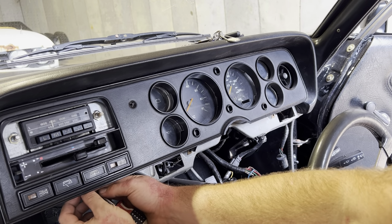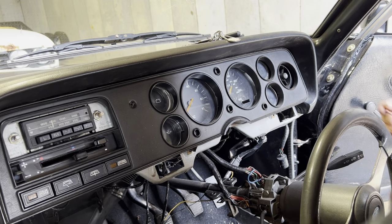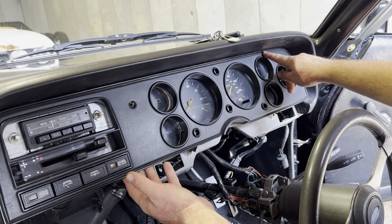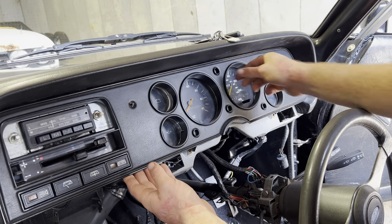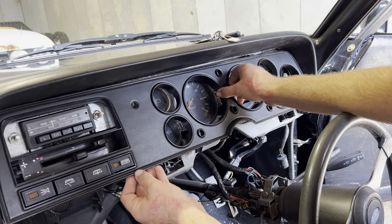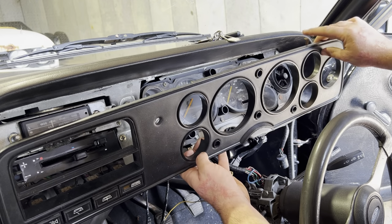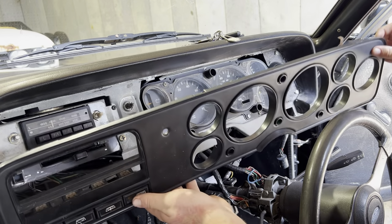Right, okay. Now, there should be one, two or three metal clips, like a little angle clip that hooks up behind the dashboard to keep the top in. And I don't know if they're on this one anymore. Yeah, they are. There's one. We've only got one. Be careful. Don't lever it. Don't pull it. Pull from the bottom and it will slide out.